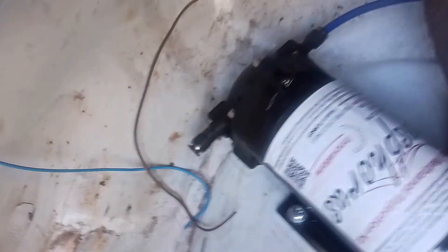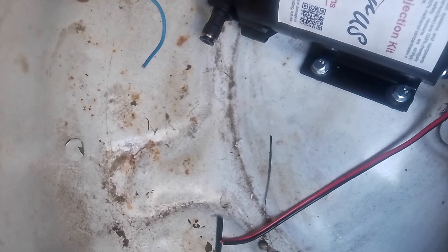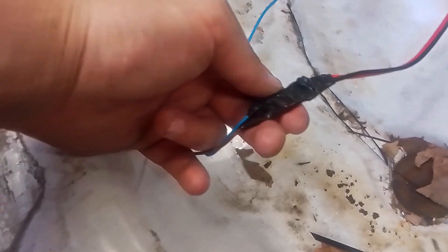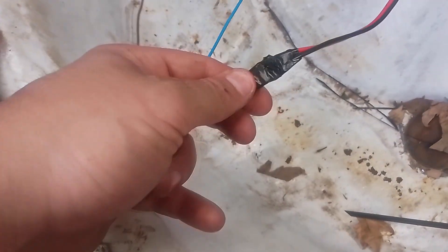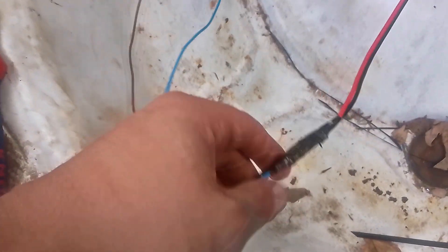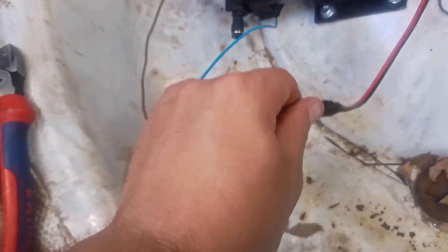Wiring at the pump is also pretty simple — we only have two wires from the pump, one is plus and one is minus, and we have two wires coming from the front which are the blue and the brown ones. We're just going to wire them up to the pump and that's basically it. As always, if you are wiring stuff, make sure that your connections are good. I've used butt connectors, which are pretty solid — make sure to crimp them right. This is important because if you lose water-meth your engine could be at risk. Also make sure to isolate everything so that if it touches bare metal it does not create a short.